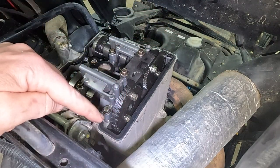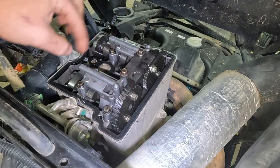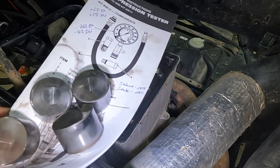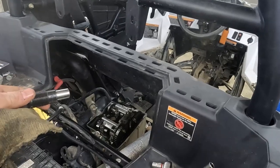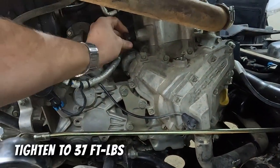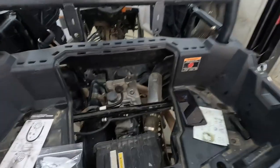So now to put it together, we can put the tensioner back in. But I'm going to measure all of these and make sure that our clearances are good first. I can't believe what I just did — I reinstalled all of the stuff without putting the tappets in. I'm going to pop that back off, put those tappets in this time, and try one more time. Got that all in, torqued down to spec. Now we're going to put our tensioner in — it's pretty easy, just stick it in this hole. You can tighten it most of the way by hand.